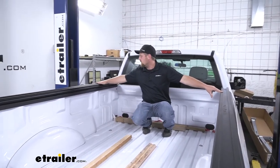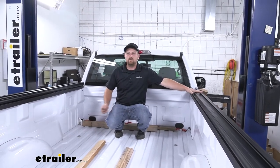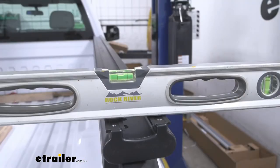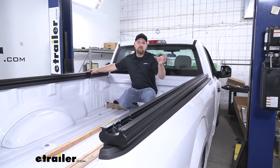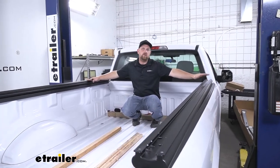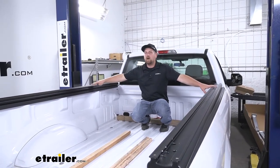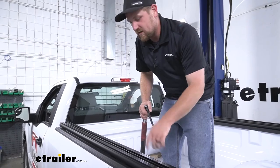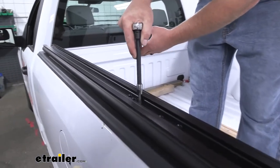You also want to make sure that the top of the base rails are flat. To do that, you can either use a straight edge and run it across from side to side, or use a level and make sure everything is leveled out. If you're not level, those plastic shims that we put on underneath our base rails — you can push those in or out to kind of adjust the pitch of the rails. Once you're all square and true, come back into each stake pocket and tighten those nuts down, then torque all the hardware to the amount specified in your instructions.